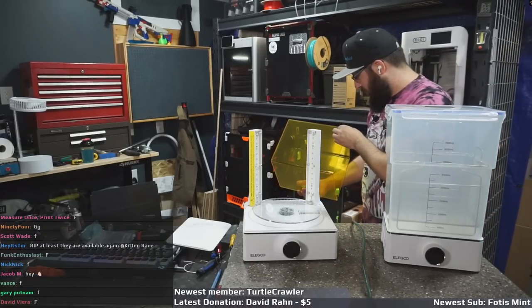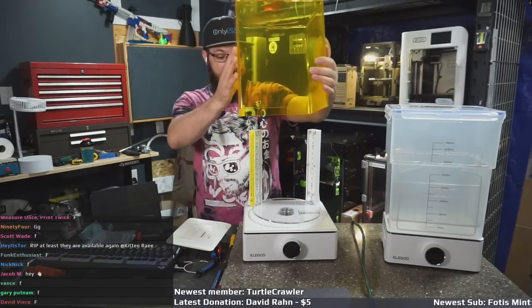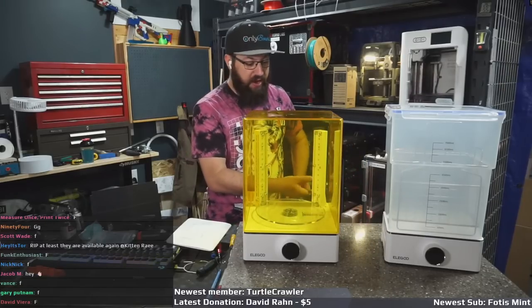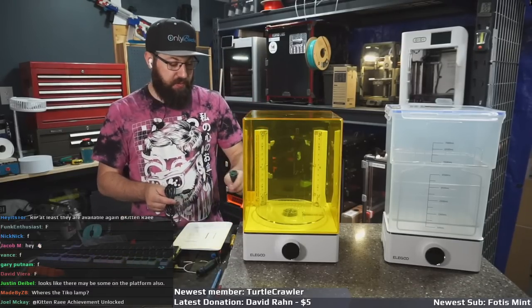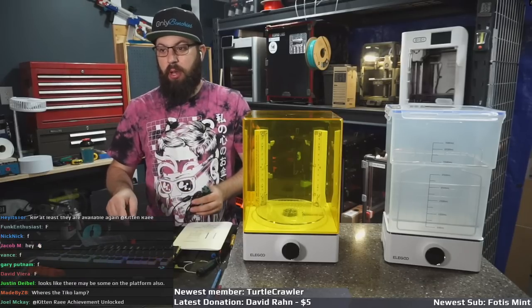The stickers used for UV protection cover detection, it should be aligned with the, oh, there's a sensor back here. That's how it knows when it's on and off. So if you ever need to run these without the lid on for whatever reason, half the time you can kind of get away by just putting a piece of tape over the sensor. They're just light sensors.